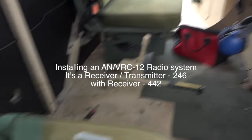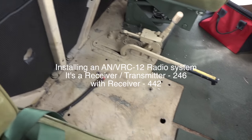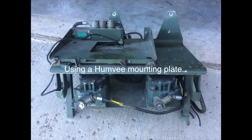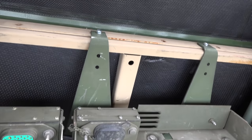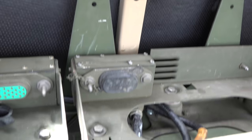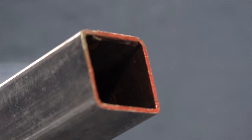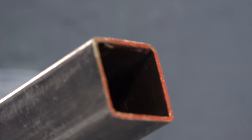Let's get back to the radio — as you can see, it's going right in between the two seats, and I'll show you what I made for it. I bolt it up here in the back and you can tell where I have it bolted to the floors down here. For the bracket, I'm going to be using one-inch square tubing and making basically a box frame for it.